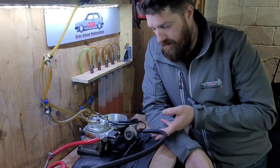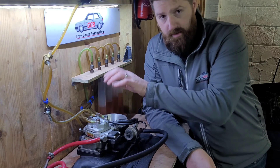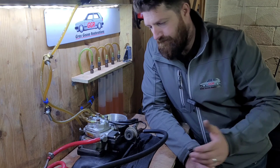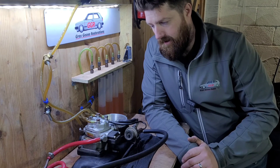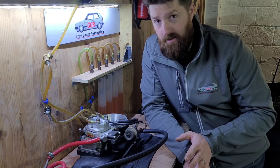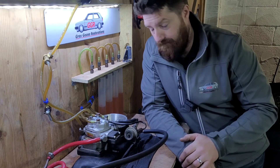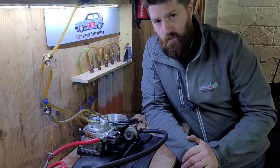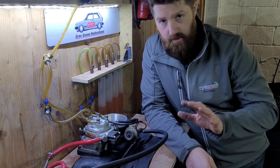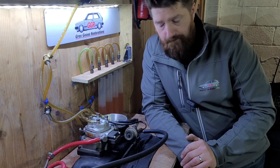On the side you can't see is an air potentiometer, which tells the system what the air flap is doing and what position it's at. System pressure comes in as normal through our red line, fills up the metering head, and comes out this pipe. On the old K-Jetronic units you've got shims you can change, but on these you can't — this is what dictates your system pressure.